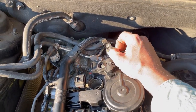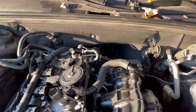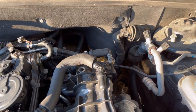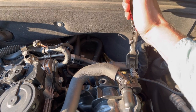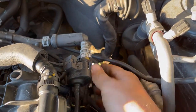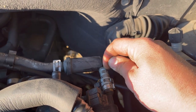Let's start by getting some things out of our way. Let's take this connector off of the high pressure fuel pump — but this is actually the low pressure sensor. The high pressure sensor is on this fuel rail right here. Then we have to get this spring clamp off right here, so we'll get our spring clamp pliers. You want to be careful not to break your bracket or anything like that. Ideally if it was seized on there, I would get one of my small right angle picks and try to separate it, and maybe try to get some penetrant oil in it.